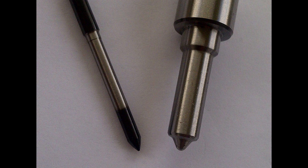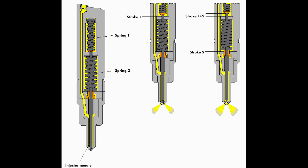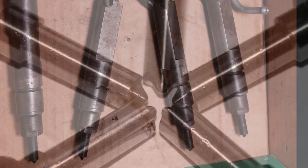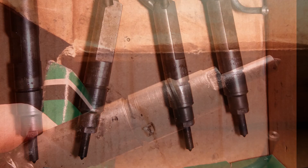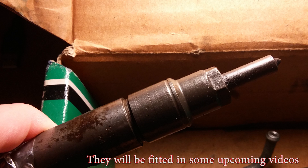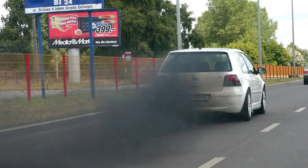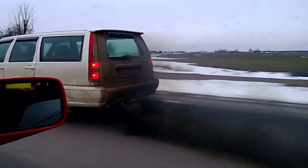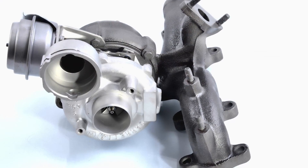After your stage one remap — or sometimes before — things get a bit blurred with the range of upgrades available. One option is nozzles: fitting nozzles with a larger hole size allows you to inject more diesel into the engine. Sometimes people just change the nozzles and get a remap to match, or they do it without a remap and end up running a little rich. On a diesel, running rich tends to produce black smoke, and the more you over-fuel the more unburnt diesel and black smoke you'll get from the exhaust.